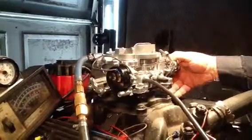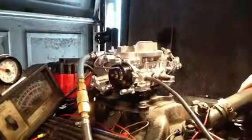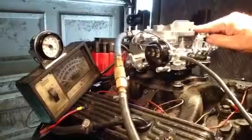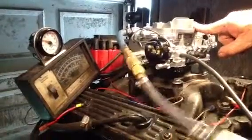Some cars want to have that emission thing sticking out, some don't — this one doesn't. We're going to crank it up and have an air/fuel ratio set right there at 12 parts of air to one part of gas. Set your timing at 30 degrees at 3000 RPM. Put an inline filter in and have three pounds of pressure on the fuel pump at all times on start.